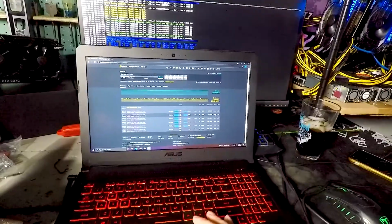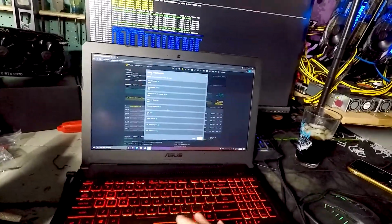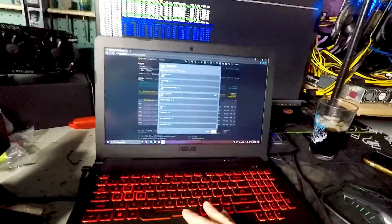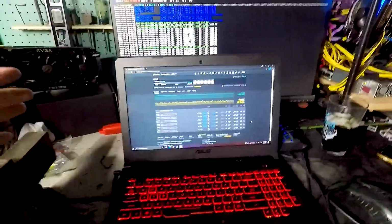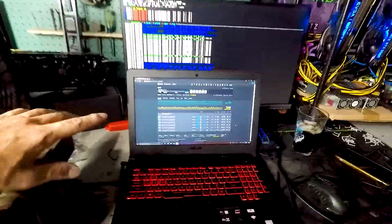So I might put that back up to 900 memory. It's at 885. Just because we're on a different board now, so it might hold a little more stable. So I am going to apply that overclock. AMD, I do have issues with doing this. It will crash the rig. We'll see if this one does.